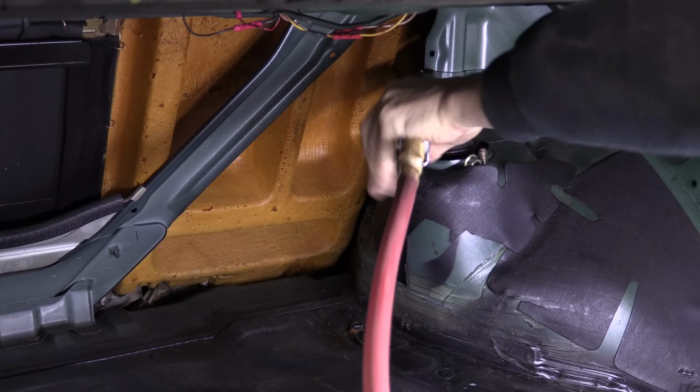I did also find evidence of a fire that occurred from power steering fluid spraying onto a hot exhaust, likely out of that eggshelled power steering line, and it ignited. It burned up and singed a few things. I mean, nothing really got burned up or anything. Based on what I see here with all the corrosion on these parts, the differential, and the fire damage on the rear subframe, absolutely everything on this likely leaks.